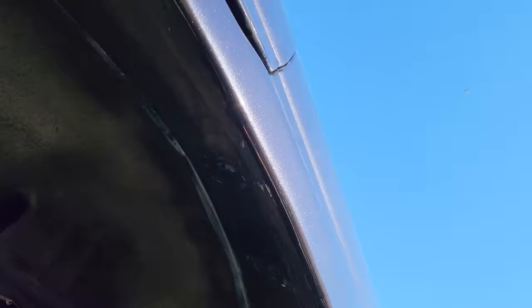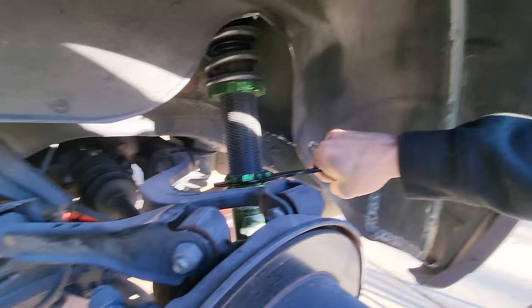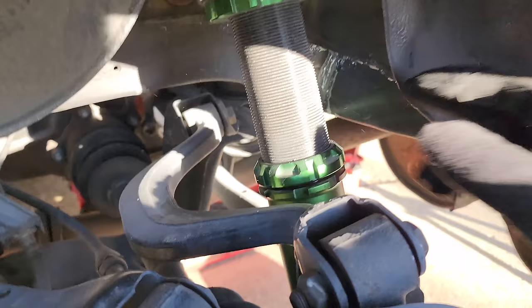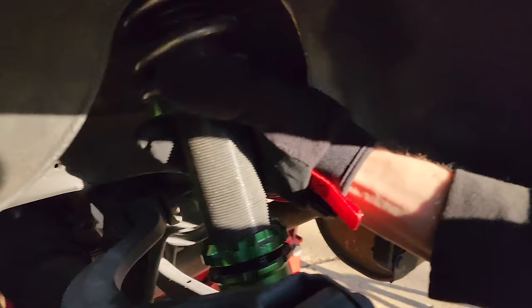To my surprise, I rolled with no issues — no waviness in the quarter panels, and now we have plenty of clearance for the tire. The next thing I want to do is loosen up the collars on these coilovers to lower them a little bit more. Loosening the bottom collar and spinning the threads into the base cup. The hard part is going to be spinning this down, but luckily these threads look brand new underneath. I'm going to spin it up a few threads, count how many, then spin it down to the collar so I can evenly do it to the other side.